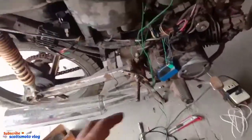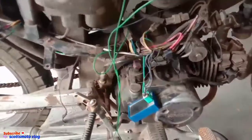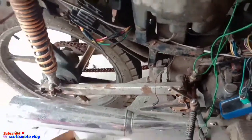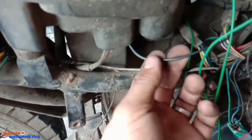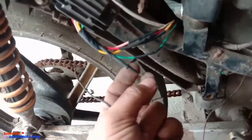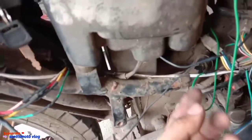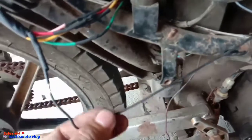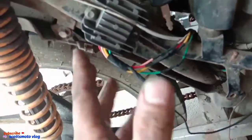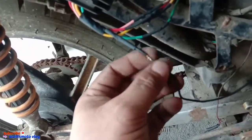It was brought here to fix the electrical. When it arrived, the electrical was completely dead — so we're not going to use its original electrical wiring. We're not replacing the whole harness either — we'll just fix it properly to avoid any issues. Okay guys, let's connect the accessories wire. This is our accessories wire — we'll strip it, then splice the wire in. Connect it here to the black wire of our rectifier regulator. This goes to the 5-pin rectifier regulator's ACC wire.